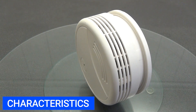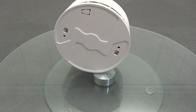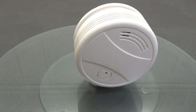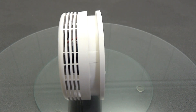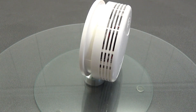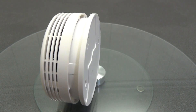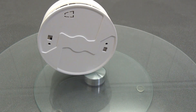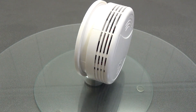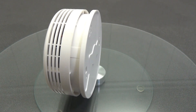Specifications. Type: photoelectric smoke detector with 360-degree circular air intake. Connectivity and app: Wi-Fi, Tuya/Smart Life app, push notifications, event log, device sharing, simple scenarios. Power: 9V Krona 6LR61 battery, not included. Charge level is displayed in the app; low battery threshold is below 7 volts. Static current: less than 10 microamps. Current in alarm: less than 100 milliamps. Built-in siren stated at more than 80 decibels, red LED, test/silence button. Operating range: 0 to +50°C, humidity up to 95%. Dimensions: 107 mm diameter, 48 mm height, ceiling mounting on a rotating base.